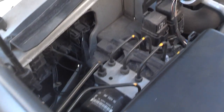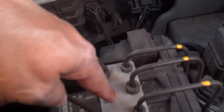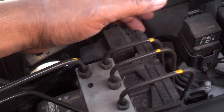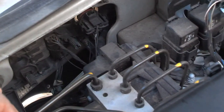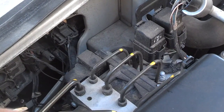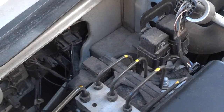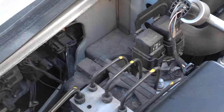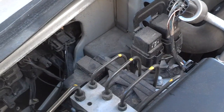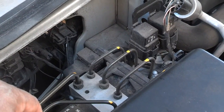The ABS system is there and the module is right here on the front of the unit. This aluminum piece has pins that stick out into the ABS controller, and the ABS controller has to come off. Most of the time the problem is broken solder joints inside that system. So you disconnect the lines, get them out of the way, take the module off, open it up, look for broken solder joints and repair them. Then reseal the module, reinstall it, hook everything back up, bleed the brakes, and the system will test and reset itself.